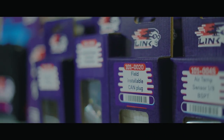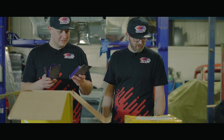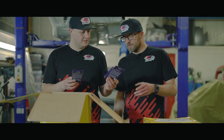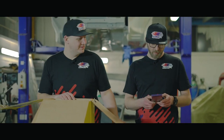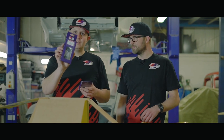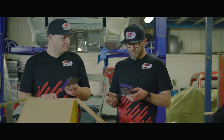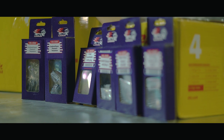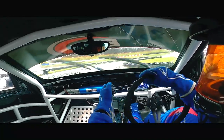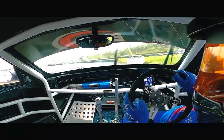Sensors — this is all a bit more technical, so over to you, Jace. We've got some new 1/8 BSP temp sensors, which we generally use for oil, water and air, and some adapters for the new fancy ones. The new four-bar ones. These are the new combined pressure sensors — I've been looking forward to seeing these. Rather than having a separate oil and water or fuel pressure and temp, it's all in one sensor. So you can just use one port on your oil line or water line, wire your temp and pressure to it, which saves wiring time and fabricating time.